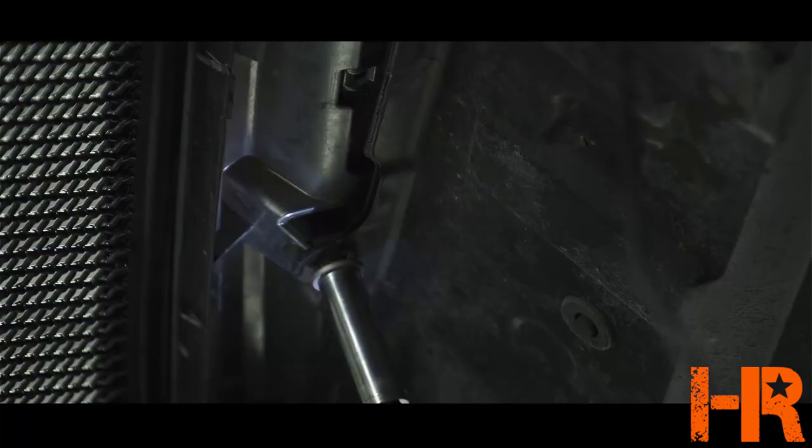On the Tundra here we actually have to remove the grill from the truck — it's attached to the hood. So we're going to open the hood, undo all the 10 millimeter bolts, and remove the hood latch release. Now the thing I recommend doing before taking the grill off is, since there are a lot of parts involved, get a camera and take pictures of everything from different angles and close-ups so that you have a reference point when you go to put it back together.